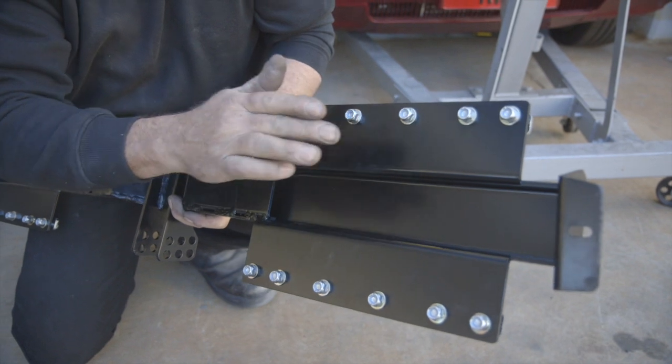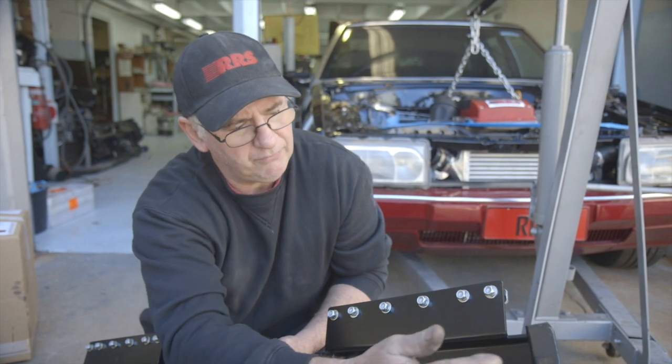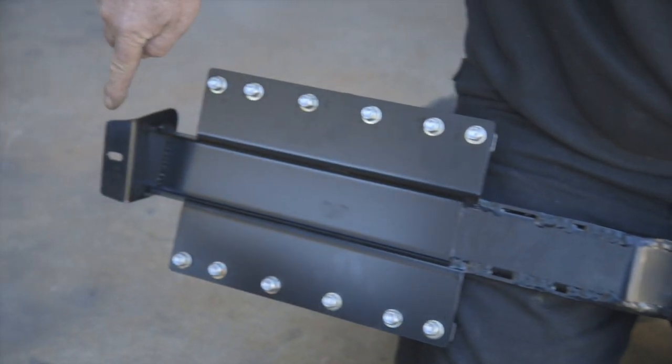It follows this contour and raises up. This is an XR to XY front crossmember that attaches to the outer seat mounting bolt holes, where there's a small subframe that comes from the outer sill panel down to the floor panel. This provides reinforcement normally just for the seat mounts, but when you tie all of this in together it becomes an integral crossmember right from rail to rail, resulting in a stiffer chassis once these components are installed.